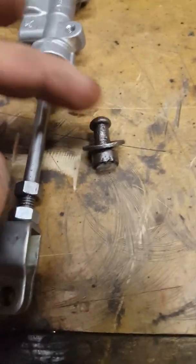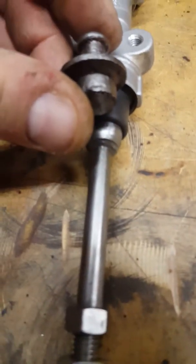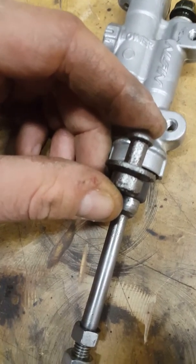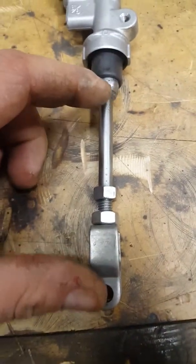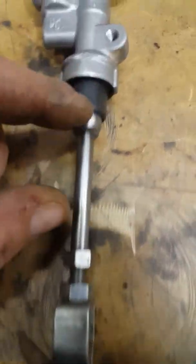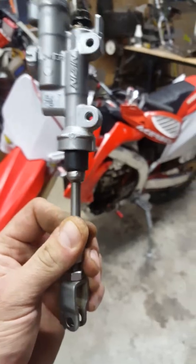That stops you from being able to use it because this little nub on the top, and this shaft is a lot bigger than the 450 little pusher. So what I did was I cut this top right off, nice and straight, and did the same thing with the 450. I put it back onto the stock 250 shaft, welded it right around and got some good meat on it. Now the shaft has the length to work on the 250R.